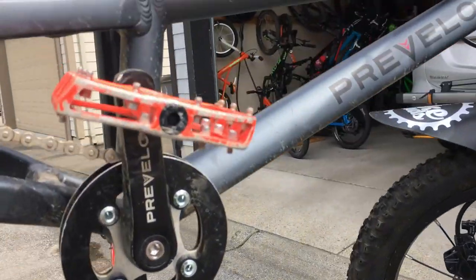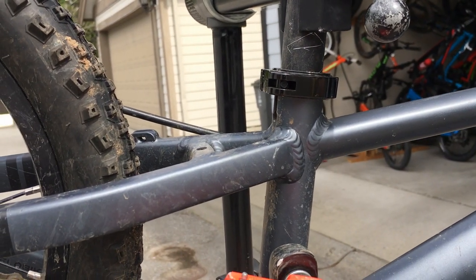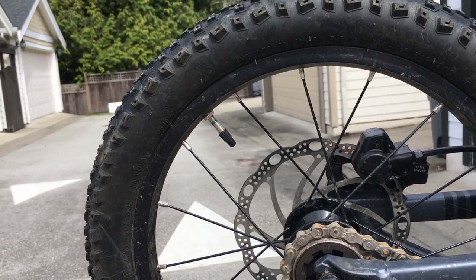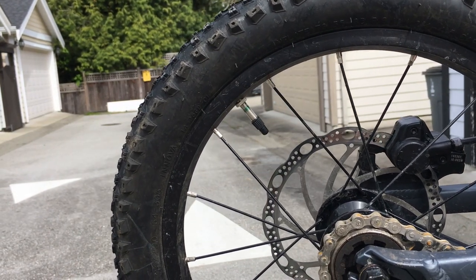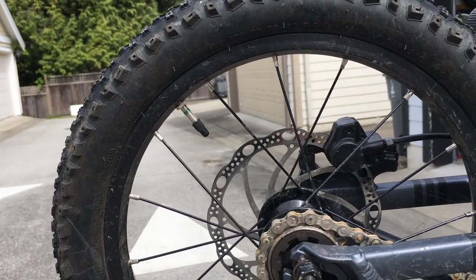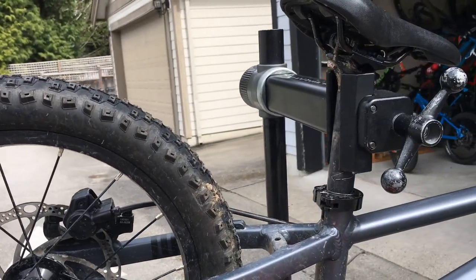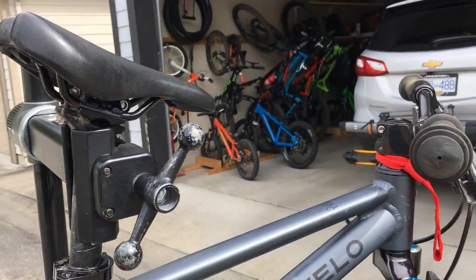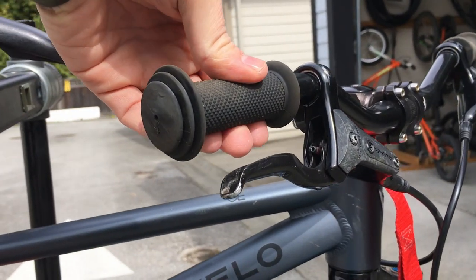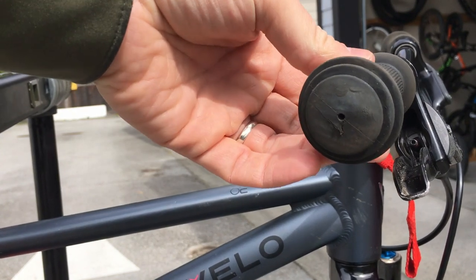Other aspects are quick-release at the seat post, so you can drop the seat after you've done your climb. It has hydraulic disc brakes from Tektro — they perform great for us. We didn't bleed them once over our six-month test period. The rotors are 140 millimeters on the back and 160 on the front on the stock bike. The bar is a bit narrower, and it has these mushroom grips, so it prevents wall strikes or their hands from hitting the road or the dirt.